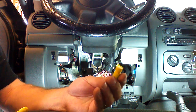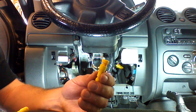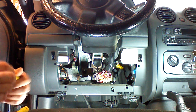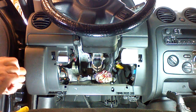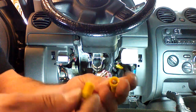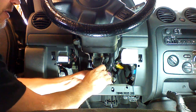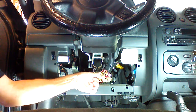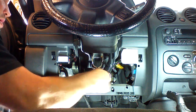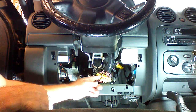I'm going to just show you two connections with this type of connector, and then we're going to go ahead and do the job with the taps. But if you want to use the PosiTaps and you wind up ordering these from me in your kit, which there'll be an option to do that, you would simply unscrew the tap and we would slip the groove end over the wire like this, and then we would screw this into the wire. And it'll screw all the way down, and there's a point that will pierce the wire.